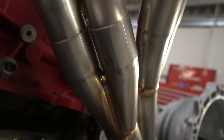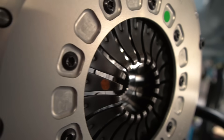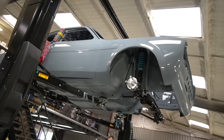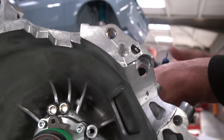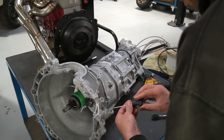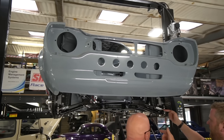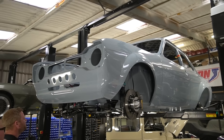Adam was working on some engine bits. We were trialling the new flywheel made for the BD engine to work with the Retro Ford MX5 gearbox adapter plate. We mocked that all up, got the clutch slave mounted in, checked the slave position was correct for the clutch — ticked that off. The flywheel, adapter plate, starter motor, and clutch have all gone off to Sherwood for the final engine when it's dynoed. We also machined out a section of the MX5 gearbox casing for clearance on the nose of the starter motor — all going in the right direction.